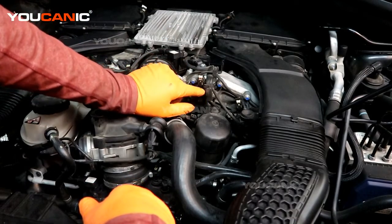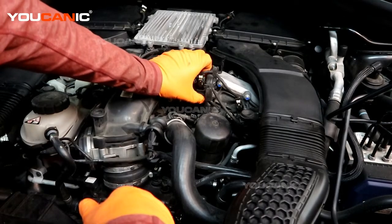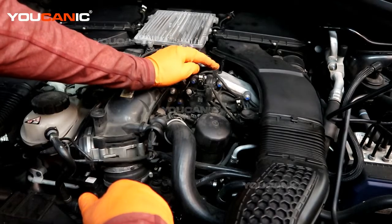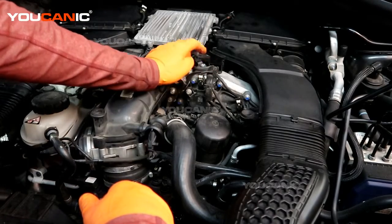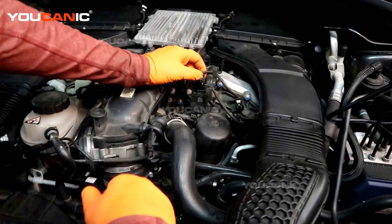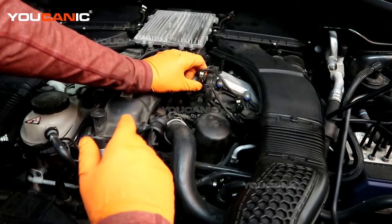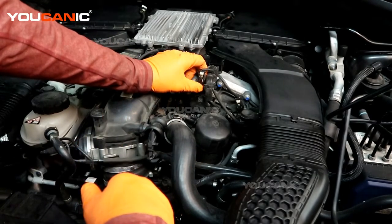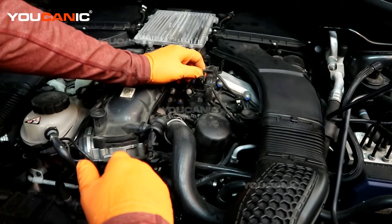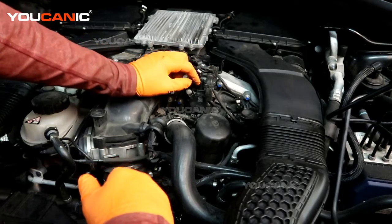This sensor here is for the intake side. If we're replacing the sensor because we feel it has gone bad, check that the electric connector is connected properly and investigate whether there are any wire frays in the connections. If you've done that, then maybe start by replacing the sensor and rule that out. To remove it, pull the little tab back, press the connector, and pull it out.